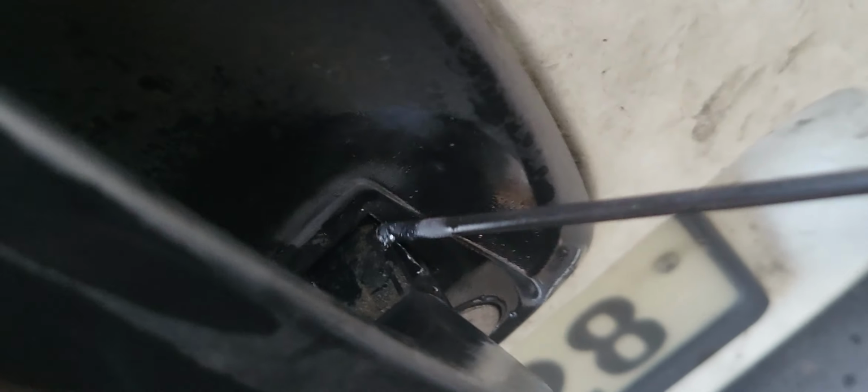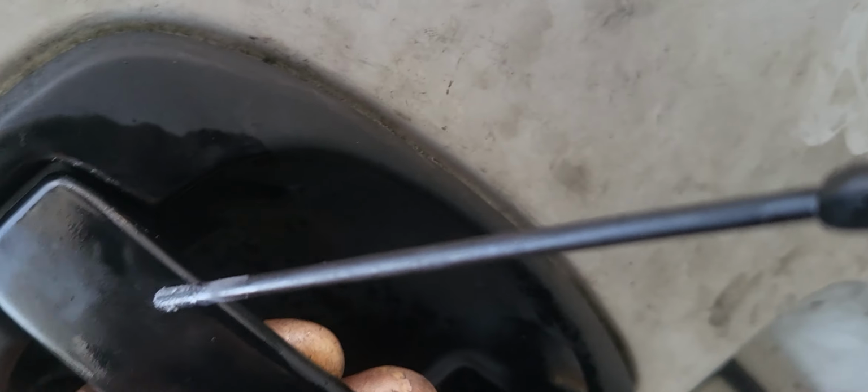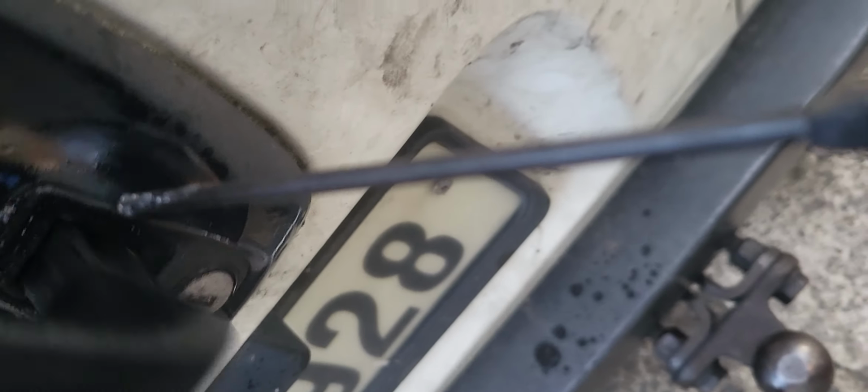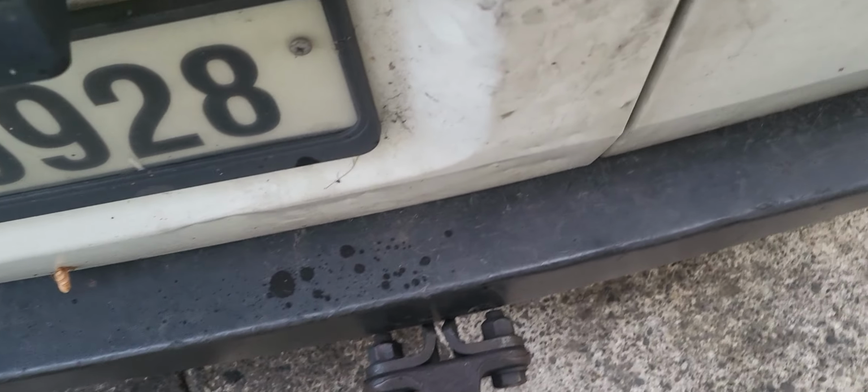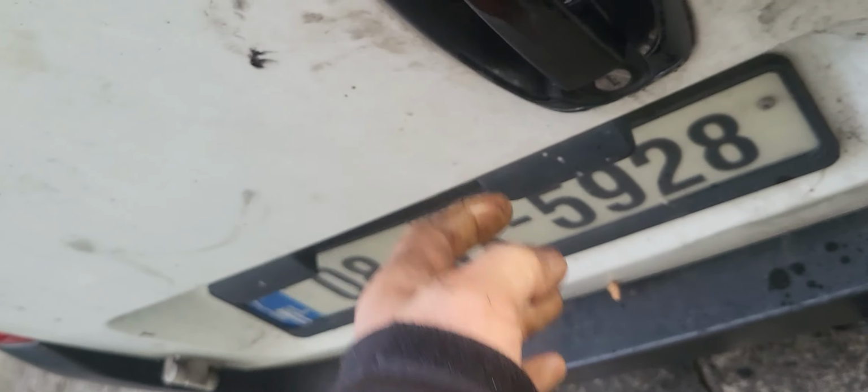While you're opening the door, you have to spray on the very inside as I said. The purpose of that is that there are lock mechanisms inside, door mechanisms that need to be lubricated. Once you have that, try to spray on the top as well. Okay, and that's it. Spray also on the key slot in here, that will serve. Okay, and that is good.